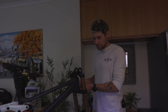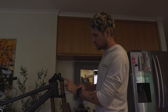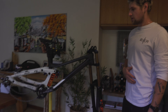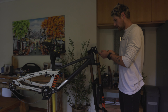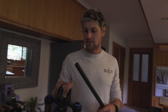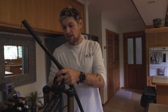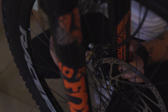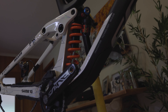So we've got a few new parts. We just cut the bars down - I run them at 786. I'm going to run my forks with just a smidgen poking out the top, 550 on the spring. It's a large frame. All Shimano drivetrain. Fox 40 suspension. I run about 93 PSI on the fork. Compression all the way wide open. Rebound kind of in the middle. I've got Syncros in-house with Scott which is lucky. So when I first went there I didn't really like the sweep of the bars or the height, so they actually gave them the dimensions I wanted and custom made these bars just to fit me perfectly.